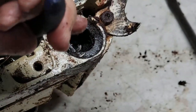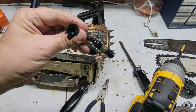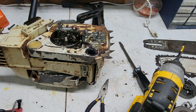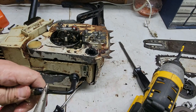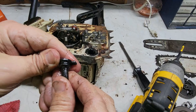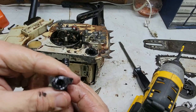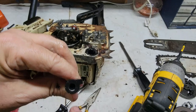As you can see, the oil line is full of oil. I've got it out — there it is. You can see it has a filter on the end of it, and the filter just pushes on the end of it. The longer this tube sits in there, the more rigid it becomes. The new one is a lot more pliable. Then you've got the part that clips into the tank — it also becomes less pliable, so the oil as it shrinks can leak out around it.